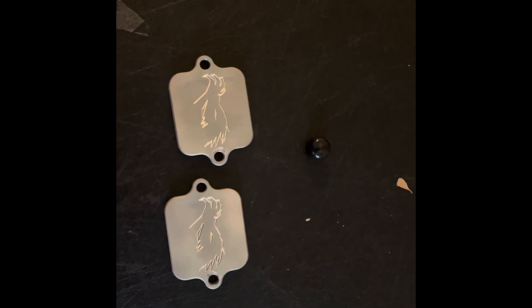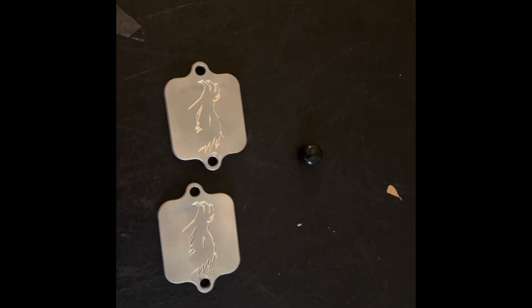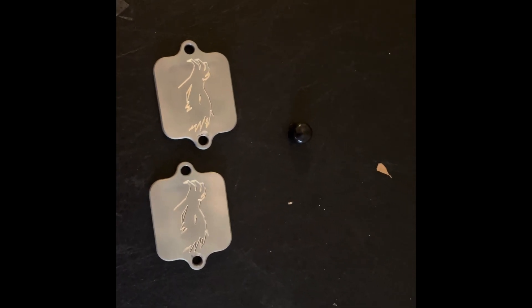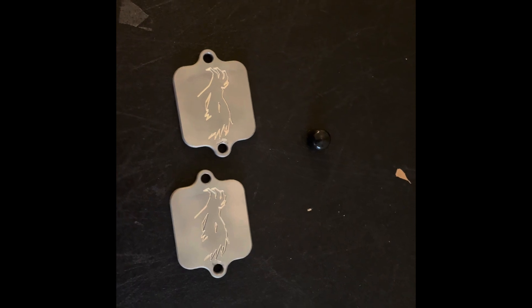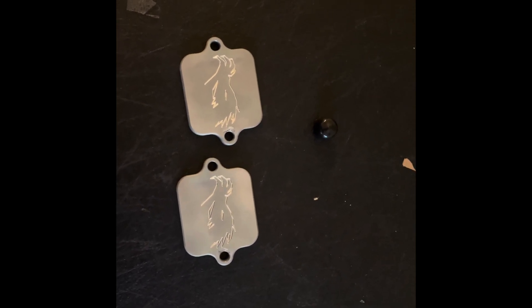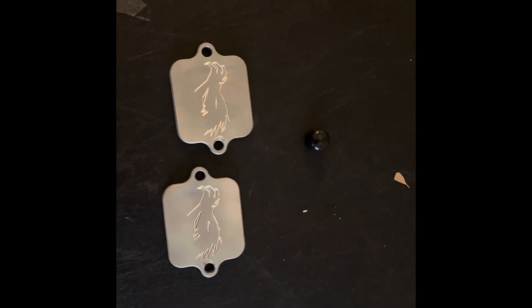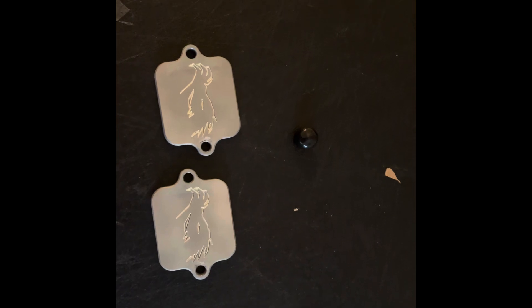This video shows you how to block that off — it's not too bad. If you like the popping on decel, let it pop. Ignore the internet people saying it means your bike is lean and you're hurting it — it's got nothing to do with that. I personally don't like the popping, and when I'm tuning I need to block off that system to get accurate air-fuel ratio.